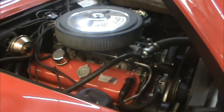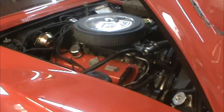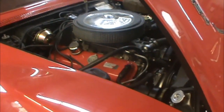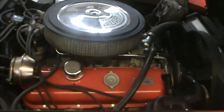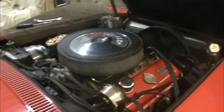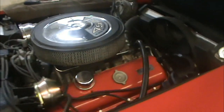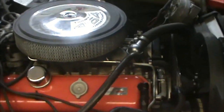I mean, 8 years is kind of unheard of for an 800 plus horsepower engine. You're not really supposed to do that. I don't recommend it, but it's a testament to how well this thing was built and the good parts that are in it. I usually say about 300 passes is when I like to freshen an 800 horsepower engine.